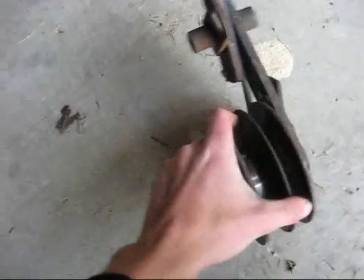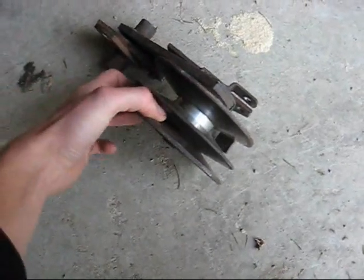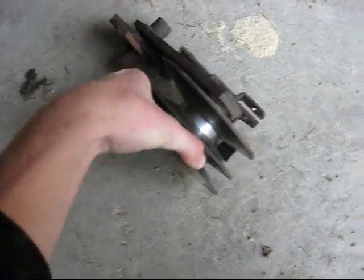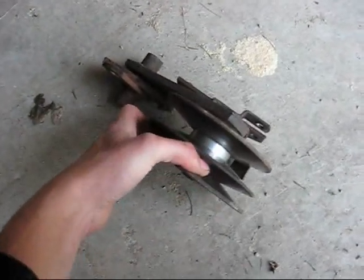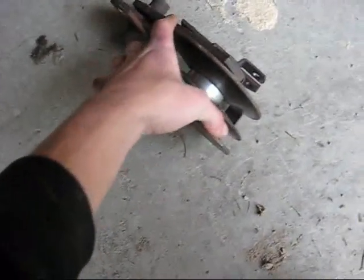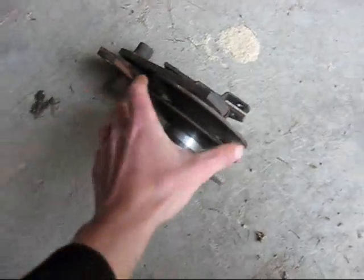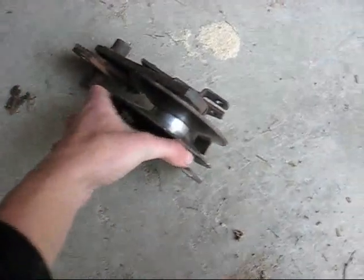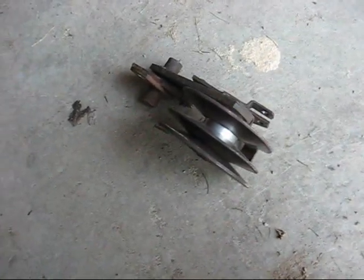I think I got the adjustment okay now. The concept behind how this thing works is this center sheave here actually can move side to side, as you can see — yeah, like that. Now what this does is it changes the belt ratio between the engine and the transaxle, giving it infinite speed ratio between its minimum speed, zero, and its maximum speed, which is about seven. It's a pretty simple design, actually, and really effective. So I'm going to demonstrate it. If my battery holds up, you can actually see it.